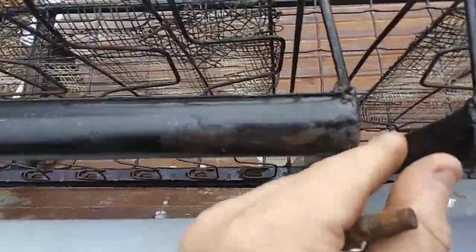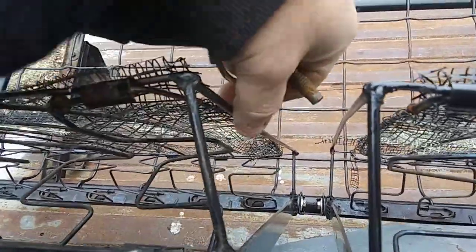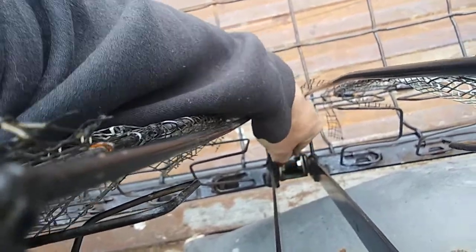What I also had to do is, when I split it down the middle, I had to measure it and put these brackets in. It's a thin steel rod I bought from Menards. I came down in here, used some angle plating, and welded two pieces of angle plating together to make this bracket. Then I put an extension down off the bottom of the backrest on each side, ran grade 8 bolts, nylon washers, and lock nuts to complete the pivot for the middle part of the seat. That way it gives these parts support — otherwise the thing would be flopping around.